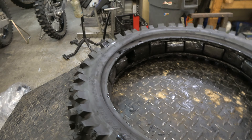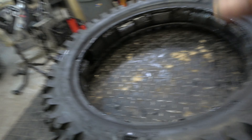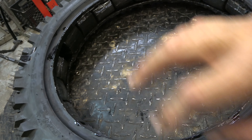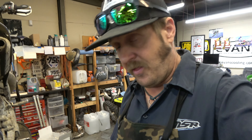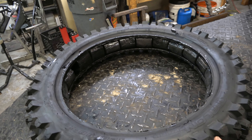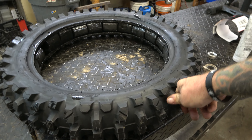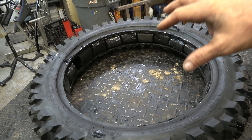So we are at a decision point. We've got them all touching all the way around and we have that little gap. If we leave it like this, it'd be totally fine. We're not going to end up with any voids while we're riding. As you squeeze it, it's going to fill that up, and as they heat up they generally expand a little bit anyway. That is not a problem, but if we take another one out and another one out to get the thing super soft, that's when I think you're going to have a problem — and that's what I don't agree with. So let's count how many we've got in here: 20. So 20 are in there right now. I personally like a stiffer tire. This in the Tusk Talon is a relatively soft knob tire, so I'm going to shove one more in there. Also, this is a 120 — when I squeeze it down it's not going to try to seat the bead because it's such a big tire. So I'm going to shove one more in there and then we're going to mount it up.